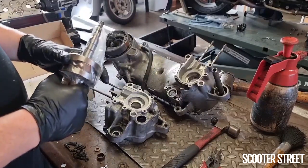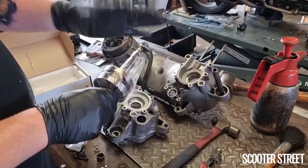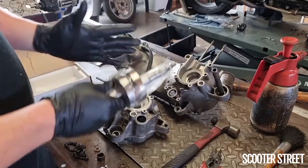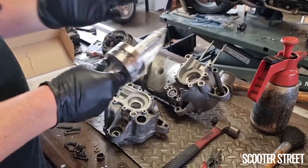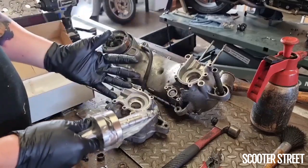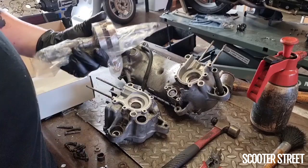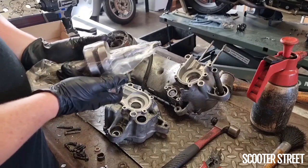It is interesting, but you wouldn't think it would make that much of a difference, just that little filling of metal. But it really does make a fairly significant difference. Obviously, if the crank is more easily drawing more fuel and air, then it's able to make more power more easily. So you usually get a fairly significant increase in torque when you install a full circle crank.